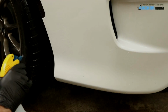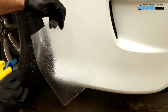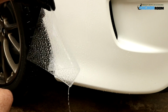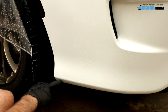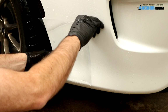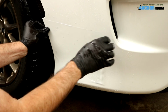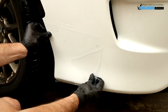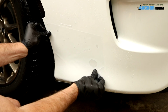Alright, last one. Driver's side rear quarter panel behind the rear wheels. Spray the surface of the car down, the actual piece itself. Again, the alignment points are primarily the curvature here. It'll fall slightly over the lip and increase, and then taper. Put the material on the car, reposition once again as necessary. But it should be right underneath the rear marker light. You can go as low as you want either way. Kind of like that protection a little bit lower.